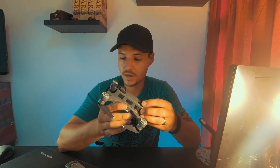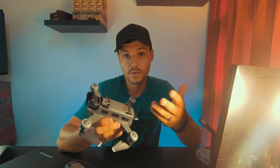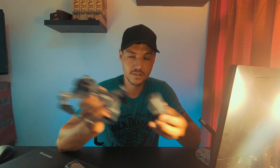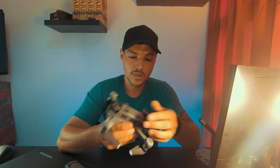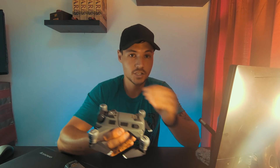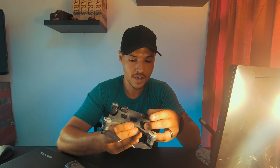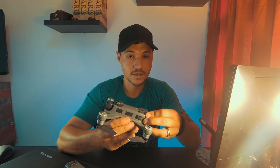Even if you've tested all your batteries and they're all fine, they could be fine today and tomorrow while you're in flight they just pop out. Once these clips are loose, you see how easily the thing literally just shoots out — loosen one clip, loosen the other, and the thing slides out. That will happen in mid-air, your drone will plummet to the ground, and you won't have a Spark anymore. If you find this video helpful, give it a thumbs up and smash that subscribe button.